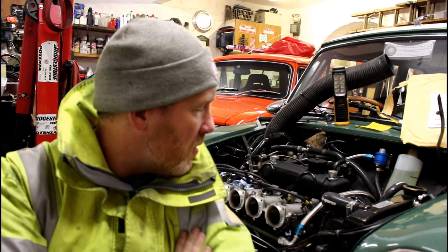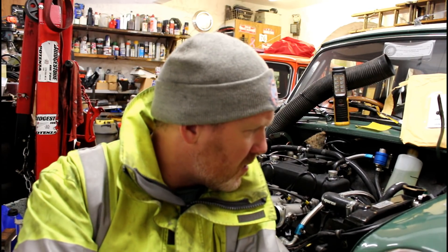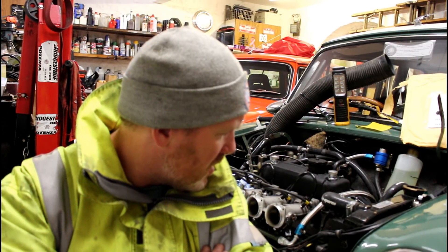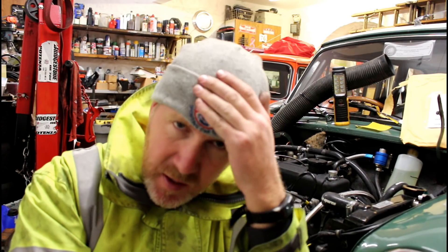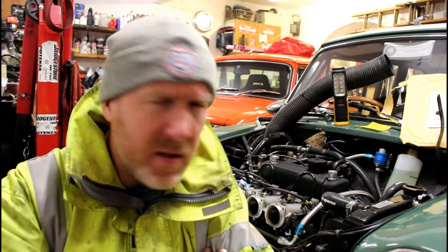I can see some pretty impressive flames in the camera displays, but it's not one to start just as yet. I just need to work out what's going on - it certainly seems to be timing related. I'll check the plugs and make sure they're not drowned. It definitely works better when you put the timing in at 78 degrees. When you put it at 258, which is the other option, it doesn't want to turn over at all. The 78 is near but not quite right.